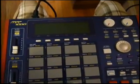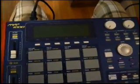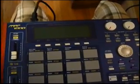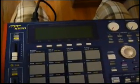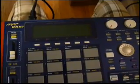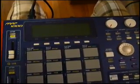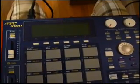Okay, so we just finished up with installing the hard drive. Now we're going to go ahead and turn on the MPC and format the hard drive to make sure that we can use all of the space on the hard drive we just installed. Now, it's important to note, you must have the latest MPC firmware installed in your device for it to read accurately. So make sure you go to akaipro.com, AKAIPRO.com, and download the latest installation for their firmware.